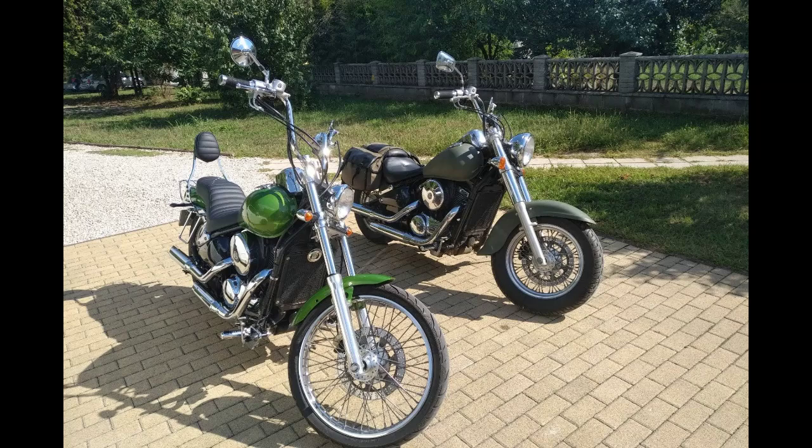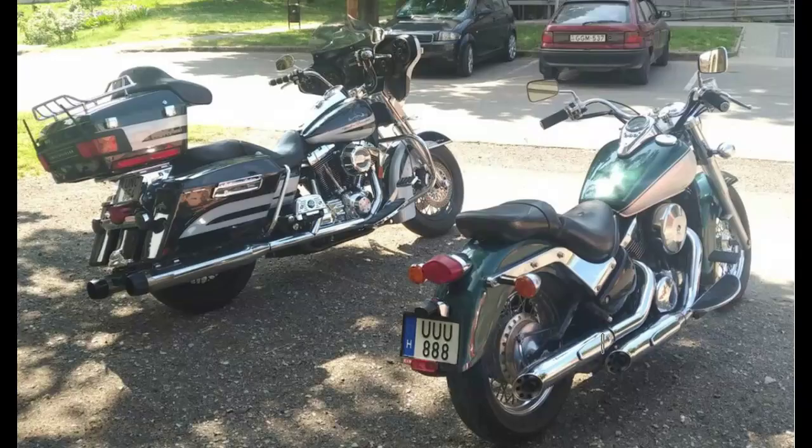So yeah, it is relatively powerful in its class. The chain drive means you can re-gear it to accelerate better or rev less on the highway. The single carb provides easy maintenance. It is easily serviced without a lot of special tools. It has a very nice V-twin exhaust note due to the single crankpin design. It gives you a decent fuel mileage.